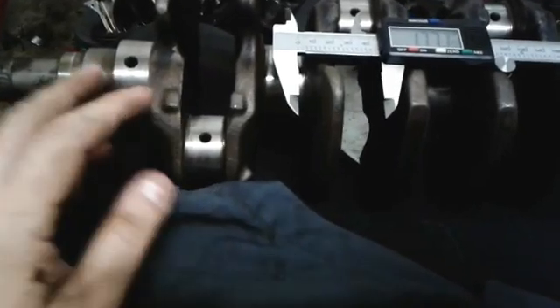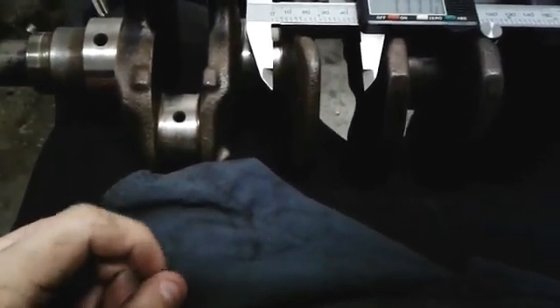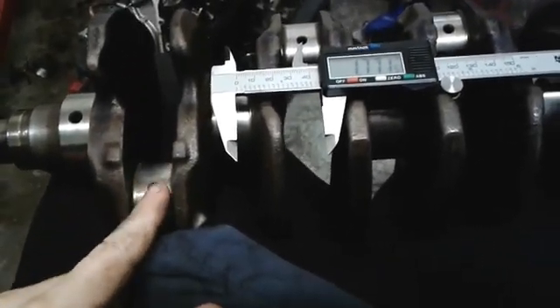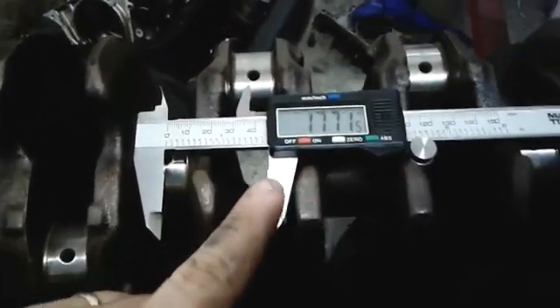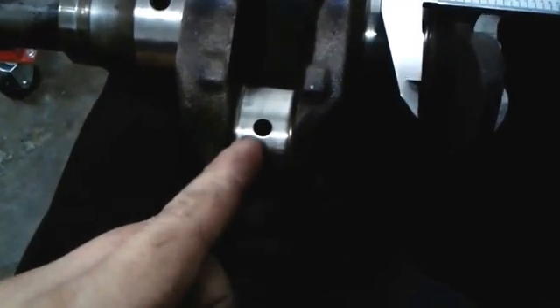As you can see, inspecting a crank — make sure that you're getting a good crank. Mainly, if you do this on a regular basis, you'll start to know just by looking at it what you're working with. What you need to do is get yourself a micrometer so that way you can take your measurements to make sure you're good. And inspect the journal itself — it should feel really smooth and glossy. No kind of abrasions on it. You shouldn't be able to catch your fingernail on anything going across. And it should be like that across all the journals.